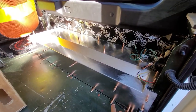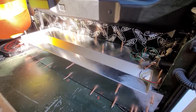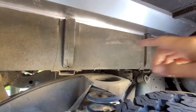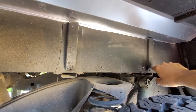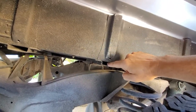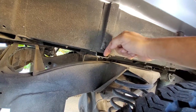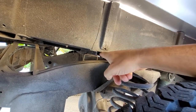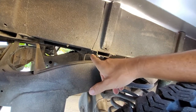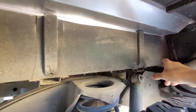For right now, I'm going to go ahead and mark this out, then drill some more holes to match the rivets that I put on the other side. Then go on the outside and remove these upper supports. I know from past experience I need to remove three of them — that one, this one, and this one — and they do fold underneath. Once I take off these bottom pieces, I can push this piece down just enough to remove the piece where it bends underneath. I'm going to be smart about it this time — just cut these off from down here with a small Dremel and saw them off, so it'll come off a lot easier on the top.